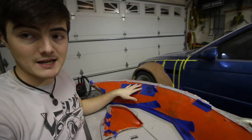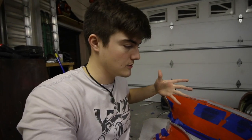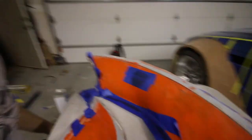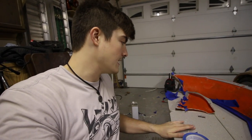I'm spraying the entire thing with PVA, so there should be no chemicals on there. I'm not touching it afterwards, so I have no idea. Comment down below if you guys know. So I took the gel coat in the bottle, squeezed it into those areas, and then I used some masking tape to flatten it out so there's not a lot to sand down. If I peel this off it should be nice and flat — it's still kind of curing but it's almost there. I'm just going to finish peeling this masking tape off so it can cure, and then I can sand it down and get parts made out of these molds.